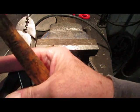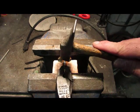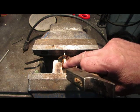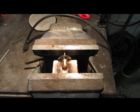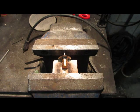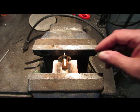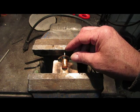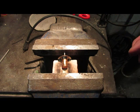I also took a pair of pliers with a washer and struck it. You have to heat it first - remember there's wax in there and the wax has to be a bit soft because you're displacing the metal case. I've done a test and this thermostat was opening at 168°F. I've given it a couple more strikes and I'm going to test it again. I'd like it to be around 165°F. So I'll have this one for 165°F, the stock one in the car set for 176°F, and the other one that opens at 160°F - a little flexibility to play with.